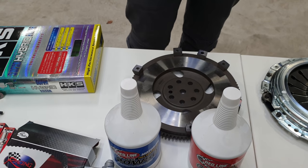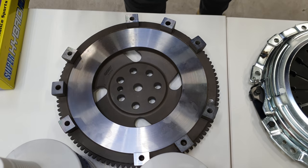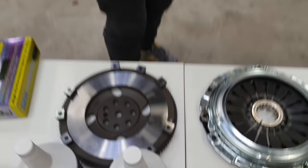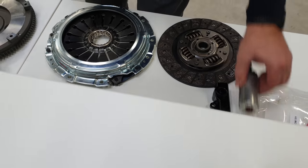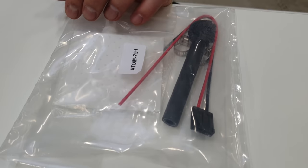Moving on to more advanced mechanical stuff — if you have a WRX your flywheel is around 14 kilos; if you have an STI it's about six. This means your shifting will be better, your acceleration will be better and everything, but vibration will be a bit more than on the WRX. If you want to race your car it's better to switch to an STI clutch because it will be lighter and it's made for more power.